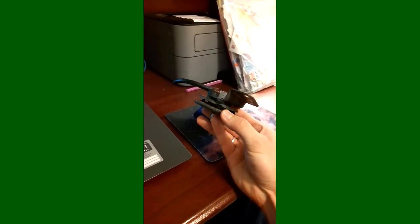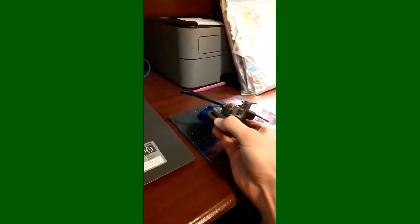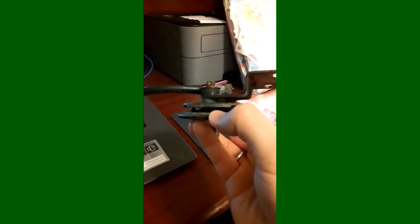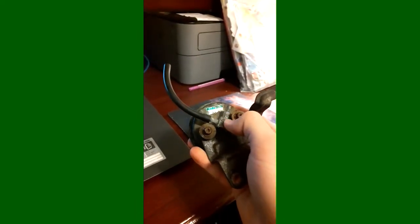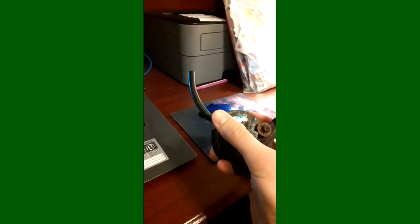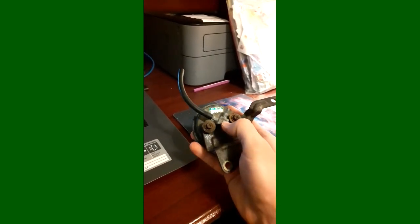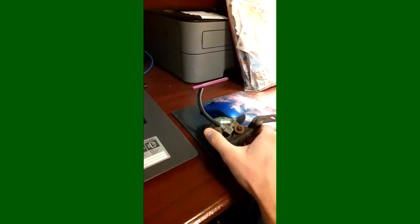So essentially you have a small vacuum leak naturally — it sucks air into this area here. Usually there's a filter in that space, but it's gone on mine because it's so old and deteriorated. Now a tiny bit of vacuum could come down this line as well, but not enough to open the EGR.